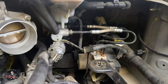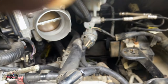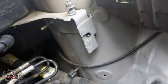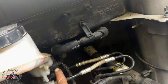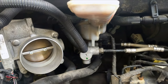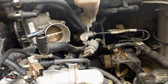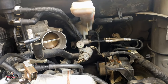The other hose is connected to this one that we've already removed from the intake. I don't know if that's going to come out of there without removing that throttle body — at least I think it would squeeze out here under with all this. This all has to get pushed out of the way. We'll have to disconnect that and then play it by ear and see what goes. The master cylinder is going to have to come off, and then I'll go inside and disconnect the booster and move it around and see what else has to be disconnected. I really don't feel like taking the intake off, although it's probably the easiest thing to do, but we shall see.